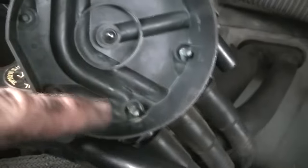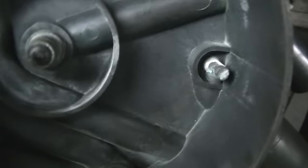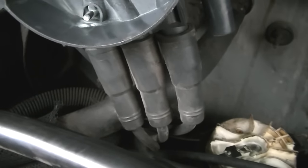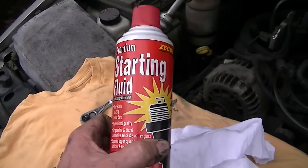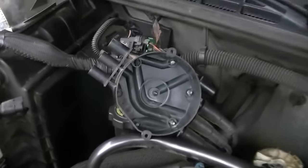If I take my finger and wipe right there - see that fingerprint - I put my finger in the middle of the cap and you can see I just wiped a little bit of moisture off. So we've got to go ahead and clean this up. It's okay to leave those three plug wires on because you can get the cap out of there. It's in pretty bad shape so we're going to do our best to clean it up and make it run. For the job I've got a can of regular starting fluid, a dry rag, and a little bit of very fine sandpaper to clean up a bit.